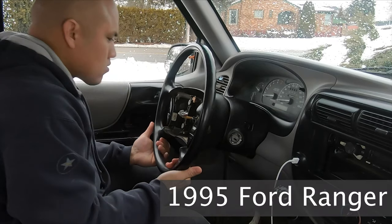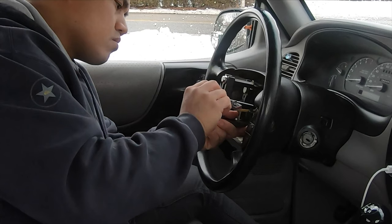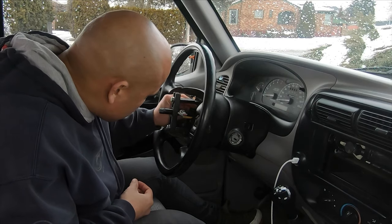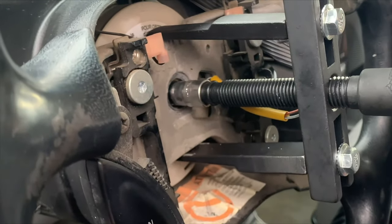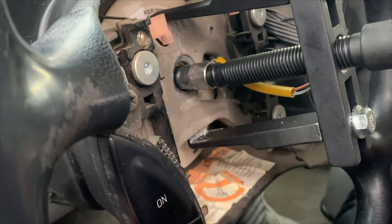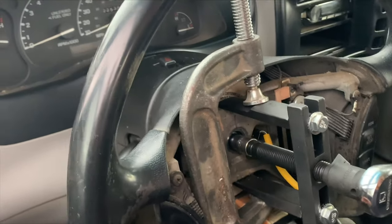You could just try and tug on the steering wheel gently, but mine was on there pretty good so I decided to try using a steering wheel puller. The steering wheel puller in this case was not working so good — the middle section was not long enough to actually reach the bolt so I had to jerry-rig and put a socket in there as an extension. I had a problem with the teeth of the puller coming apart — you can see it slipping right about here and then the whole thing would just come undone. So I used a C-clamp to tighten it all down and keep it together.